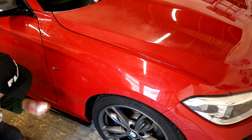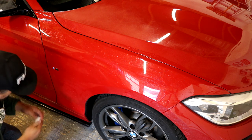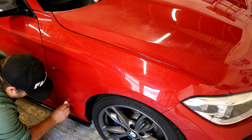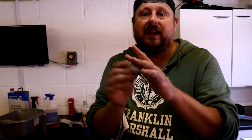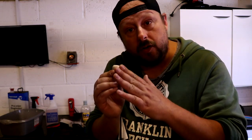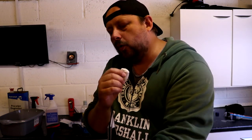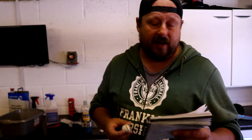How often should you replace clay? Most manufacturers recommend about three or four cars. After that you start to see it get dirtier. The clay pulls in contamination constantly as you refold it — the more contamination in the clay, the more debris on the clay surface, and the less effective it becomes at pulling contamination off your car while also causing more scratching. So the dirtier your clay gets, the less effective it is. After about three or four goes, replace it. Don't use really dirty clay.